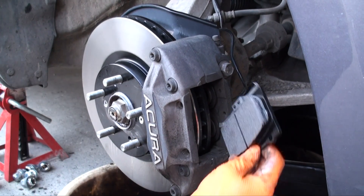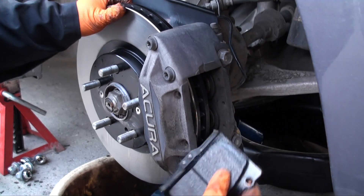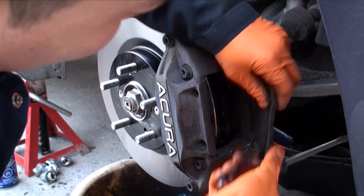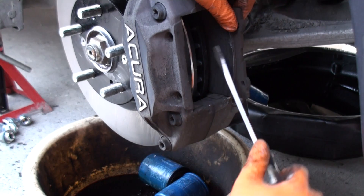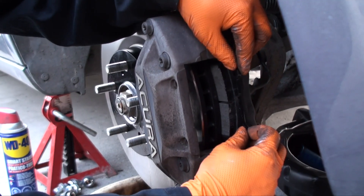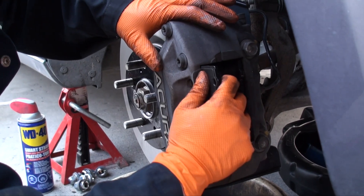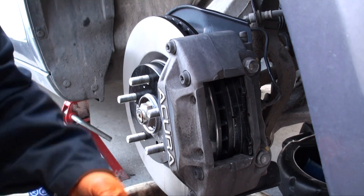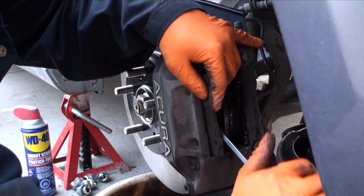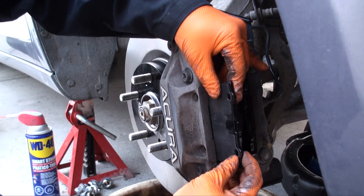To reinstall them, you just do the reverse of removal. We want to slide our pad in with the brake material facing the rotor. Now if you're having trouble sliding this pad in, which should require minimal effort, you can actually take the old pad and a screwdriver and carefully pry the pistons out a little bit more, because sometimes they do move around a little bit. Slide our pad in and install the outer pad, again with the friction material facing towards the inside of the rotor. If you're running into problems where you can't get the pad in, just take an old pad, fit it into the space between the piston and rotor, and then carefully pry against your brake pad to retract the pistons so that you can insert the new pads.